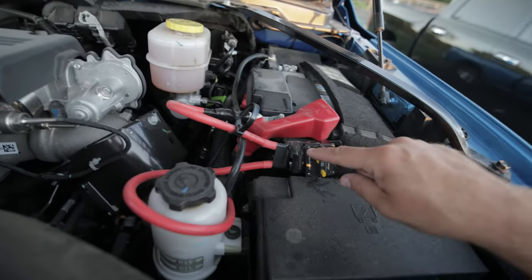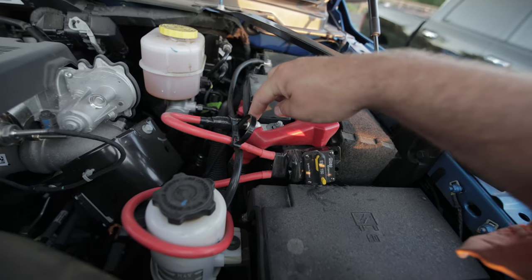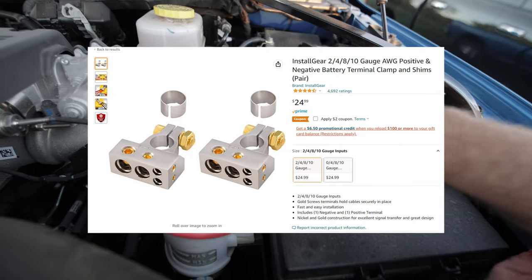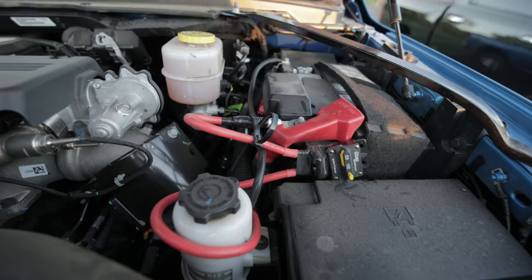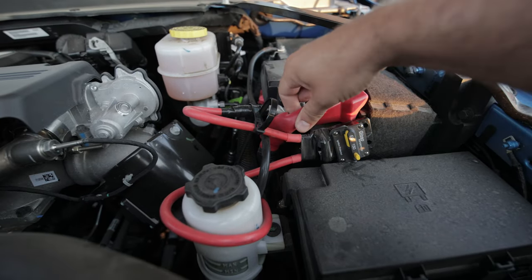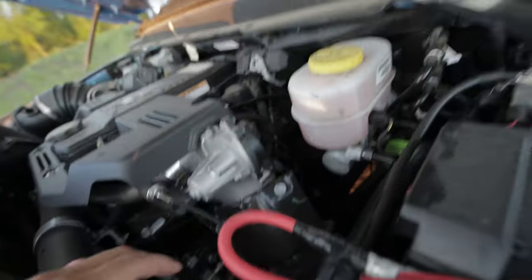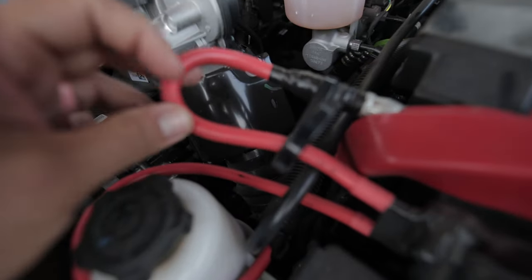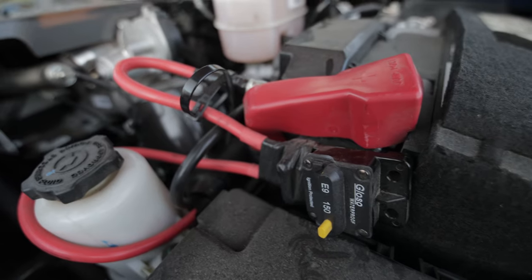It's really straightforward — the wire comes in one side of the breaker, goes through, and comes out the other. You press a lug onto each end. I used a heavy-duty number one lug — a little overkill, but solid. I added contact grease where it makes contact, then secured all the wires with zip ties. The engine bay gets extremely hot, so make sure the wires aren't touching anything really warm, so you don't get a nick in the insulation and start a fire.